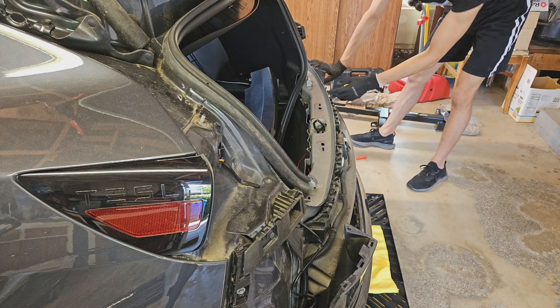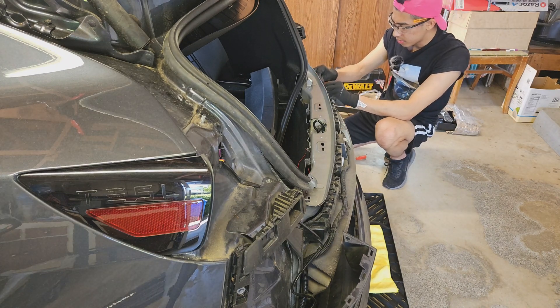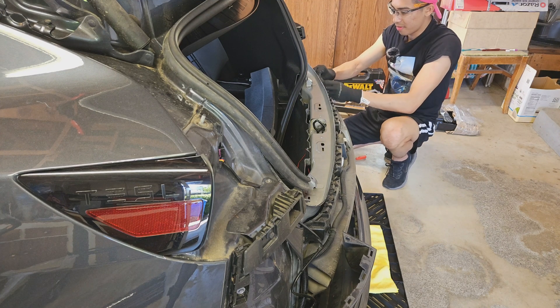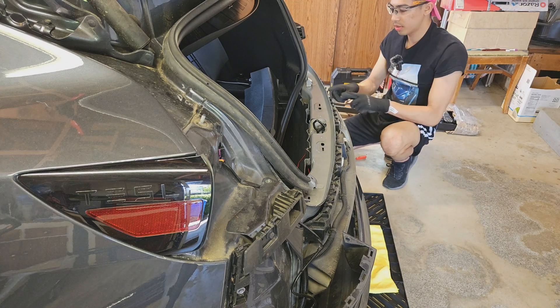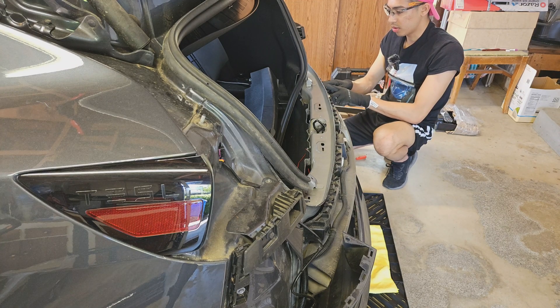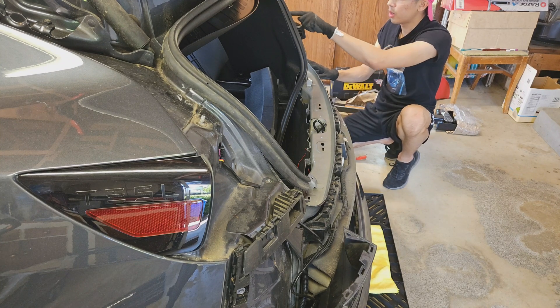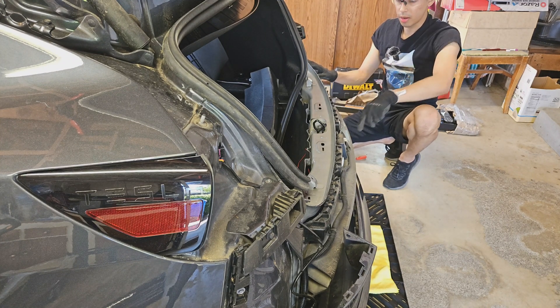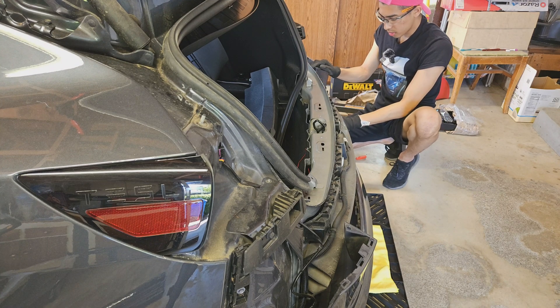If you have an older Model 3, you'll also have a sensor cable — the whole harness. You just need to disconnect the big plug — it should be on the right rear of the car. Make sure you disconnect that before you pull the bumper. If you have any lights at the bottom replacing your reflectors, those are the black wires going along the side — you can see where they come out from the tail light hole. Just be careful with any wiring harnesses.